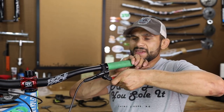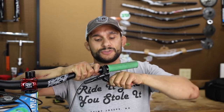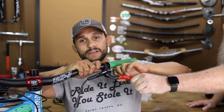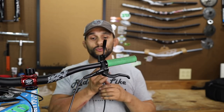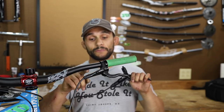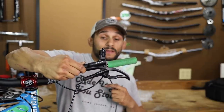The neat thing about the GT Aggressor Pro is we thought it would be the best bike to install these on because it has the four-piston hydraulic brakes - the MT420s, Shimanos. The cool thing about these Zoom brakes is they actually say they are compatible with the exact same pads you use with your Shimano MT420s. I thought that was pretty neat. You can see the two pistons there and the two pistons on the other side - there's actually a pretty good bit of room in there. And I think on the site they advertise like 25% more stopping power. We're going to find out on the real-time review.